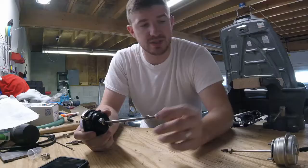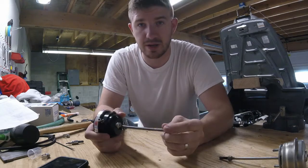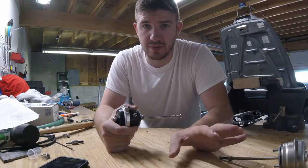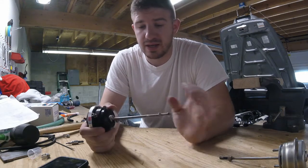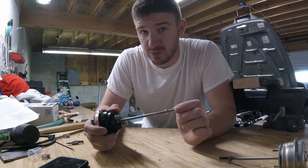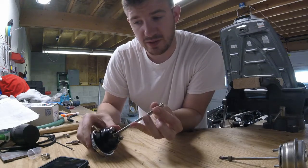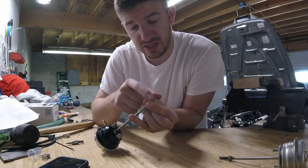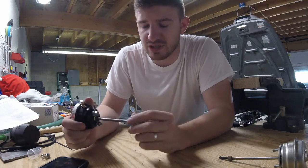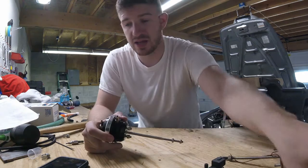As opposed to the single port one where it cracks open at 11 psi, back pressure would just blow it open — and that's what I think may be happening. So we might be able to pick up some spool on the bottom end, and we should definitely gain better control of the system with the twin port. Instead of pre-loading this one to dictate where it cracks open — which went from about 2mm preload up to 10mm that Borg Warner recommends — with this twin port we can control it better. Turbosmart recommends putting 2mm of preload: because it's an M6 by 1 thread, you bring the nut up finger tight, mark it, and spin it two full revolutions to give 2mm of preload, ensuring no slop and that the gate already has some force against it.